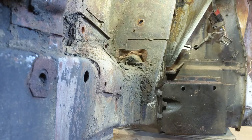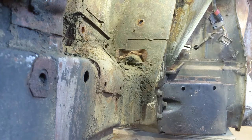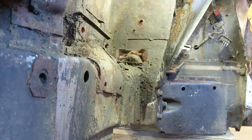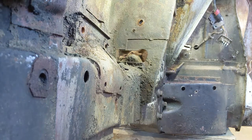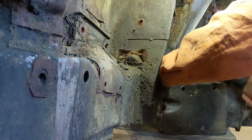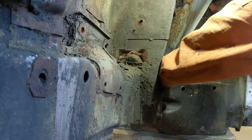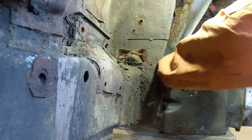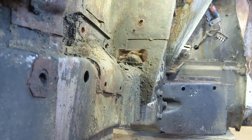There's the other one. They're fine thread, and like I said, they're 7/16 12 point. If anybody's doing this out on the bench, I'll get that socket out after. I'll see if that rag joint will move. There's my little pry bar right here. There's no point in taking the bolt off the power steering. Oh yeah, that's loose on there. Good, good, good. All right, let's go after the bolts for the power steering box.